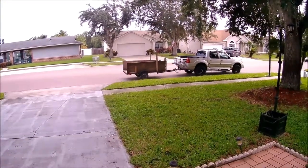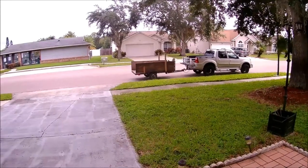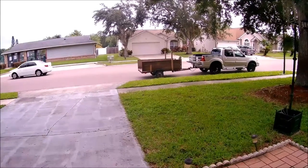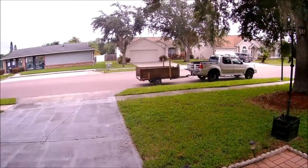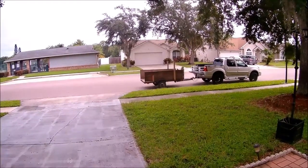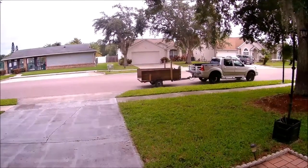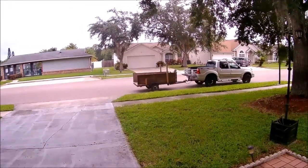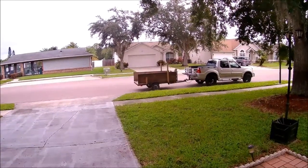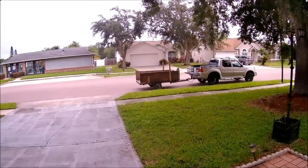Welcome back everybody. I have a little bit of a hard time whenever I load my zero-turn lawnmower on the back of the Harbor Freight trailer because it ends up sitting up pretty high — about 18 inches. So it's pretty steep for the big mowers to get on top of the trailer. The only real way of lowering a trailer is swapping out the axle, which puts the axle on top of the leaf springs and gives you about two and a half inches. The only other way is to get smaller tires.